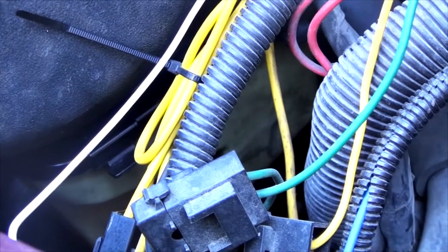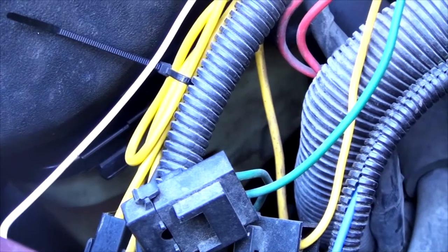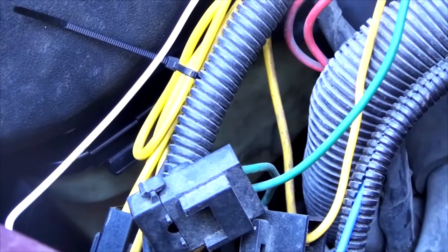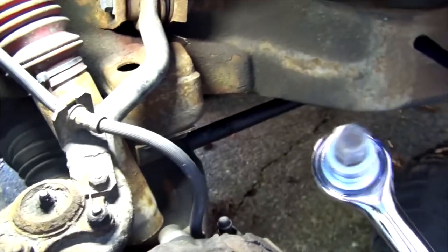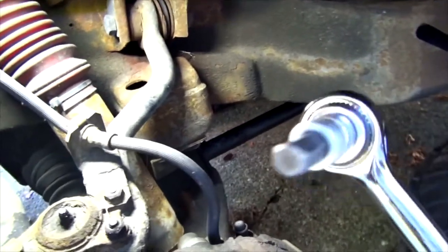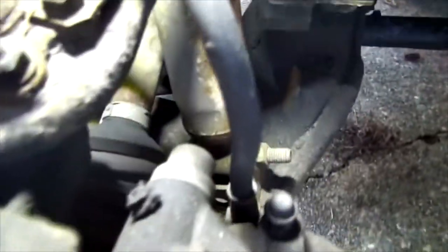The heat temperature of your rotor should differ side to side if a caliper is sticking — that's how I confirmed it on my friend's Audi. The temperature was significantly higher on one side. It's an invaluable tool. During this process your brake fluid level will change — check it beforehand. Just because it's low doesn't mean you need to fill it, because as you push that piston in, the fluid is going to come back up. You'll need the 3/8 hex socket since these are hex bolts.